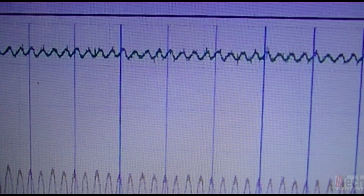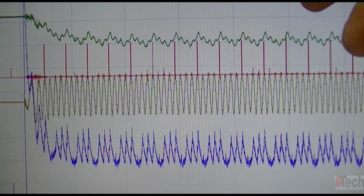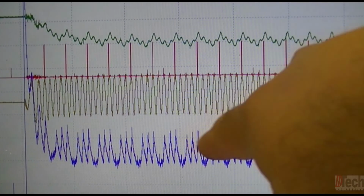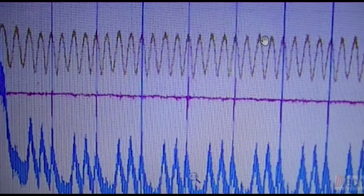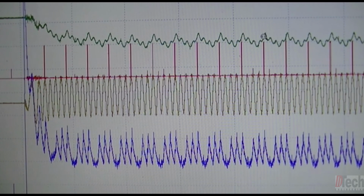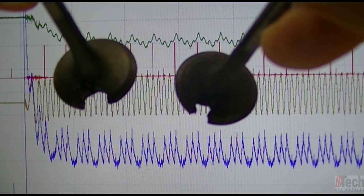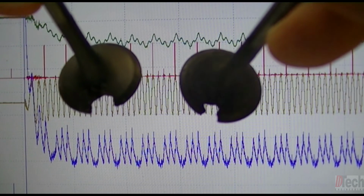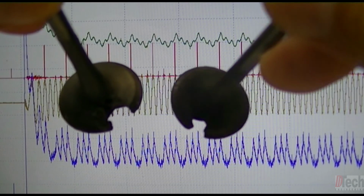And I know 100% that it's due to a leak, and not due to an RPM change causing that, or positive pressure, obviously we know that, because both have the RPM inconsistency, and one is affected and the other is not, and it's in the same cylinder. So the only thing that is different, again, between the two is the size of the leak when it's on its intake pull, and it should be a sealed cylinder. That right there is enough of a size difference that it can throw you for a loop on that intake trace.